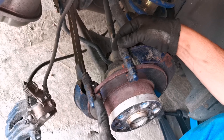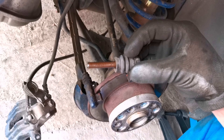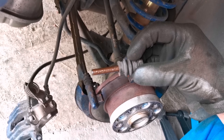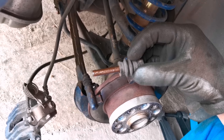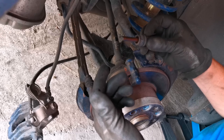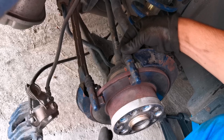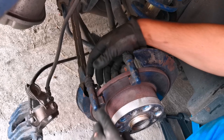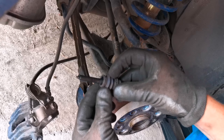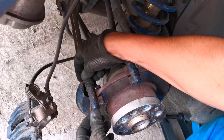After that, you have to check if those two little metal parts are well lubricated. If not, you have to lubricate them. In my case, those are very well lubricated and I am going to put them back. Those parts are helping the caliper to move back and forth when pressing the brake pedal, and if those are stuck, the brake will not work properly. This one is in very good condition — it is coming very easy back and forward. And the second one is also very well lubricated, so now I am going to put it back onto the caliper mounting bracket.